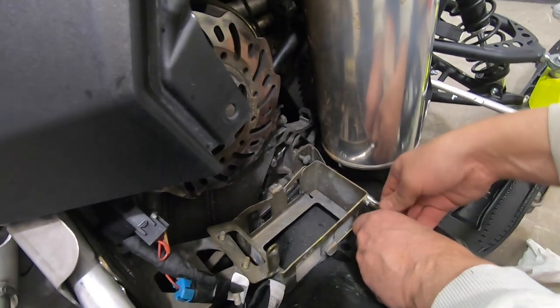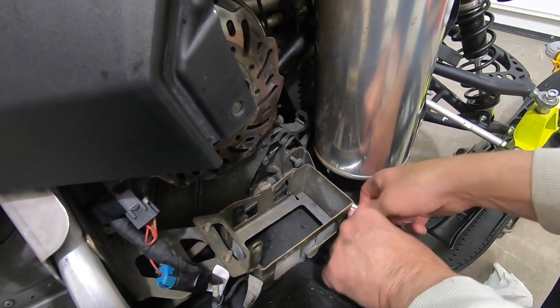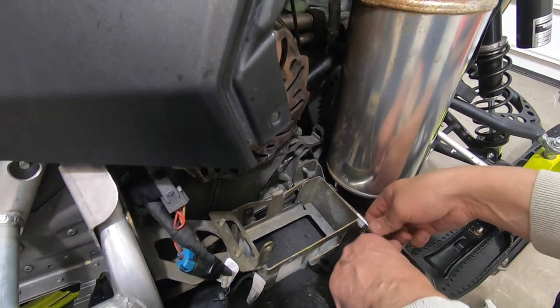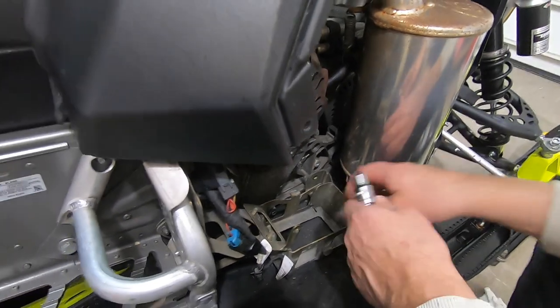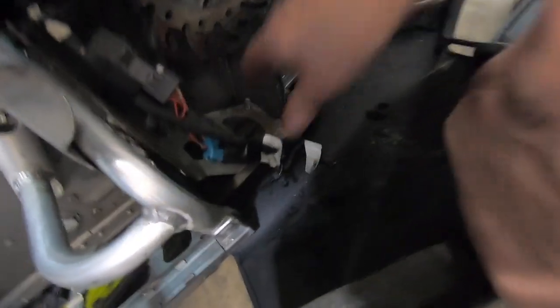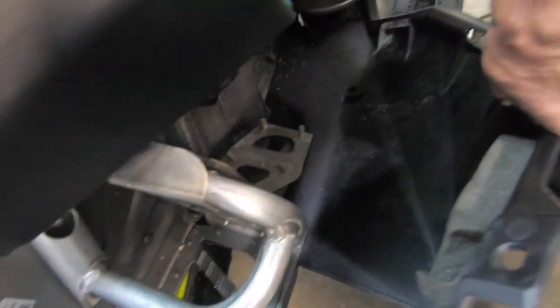On my sled it's not electric start, but if you have electric start, you've got to remove the battery box. I bought the power-up kit for my PIDD gauge and I just have a little lithium battery that's zip-tied in here. With the power-up kit you get this bracket, so I needed some way to secure that little battery and I installed this bracket. But to remove your track, you're going to have to remove the bracket. This bracket is a two-piece design. To get out these bolts, it's just too difficult with that in the way, so it's easier just to take these two nuts off and do it as two pieces.